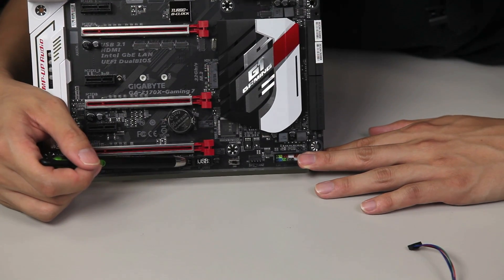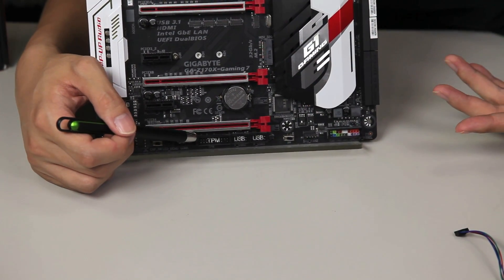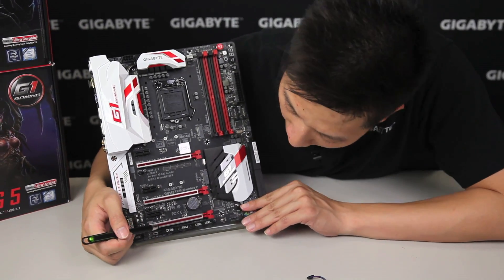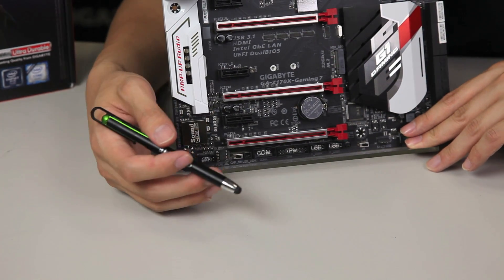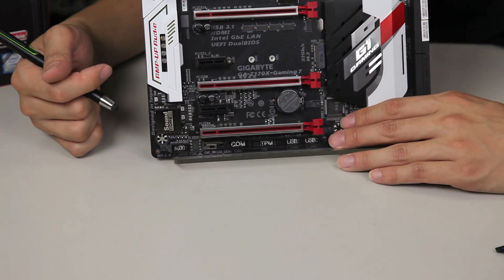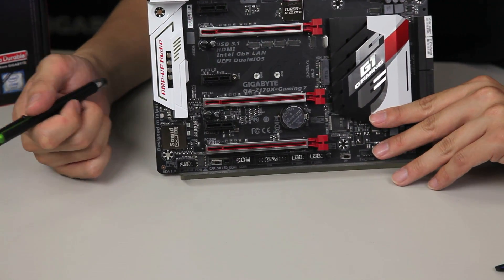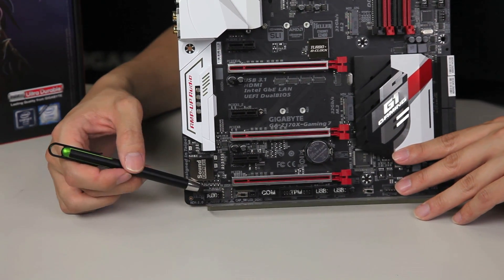Moving over, we have an additional two USB 2.0 headers. We have a TPM pin header — TPM stands for Trusted Platform Module and is mainly for security. If you want to secure your system, you can look up TPM to see what it can do for you. It's not something we usually see regular consumers using. We also have a COM port header which gives you connectivity for other I/O devices. And then gain switches right here — if you're using headphones that need more power or output, this gain switch allows you to switch between 2.5x to 6x. We also have an upgradeable op-amp, which you've seen with Gigabyte's exclusive AmpUp audio technology, and your front panel audio header is here.